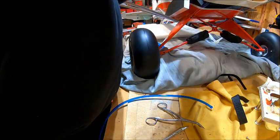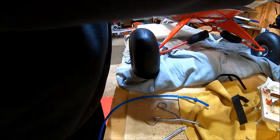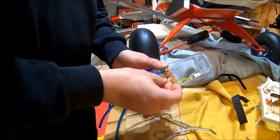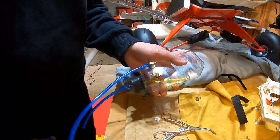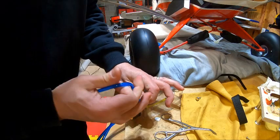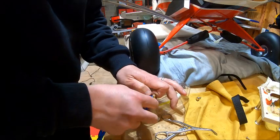Now I am going to take this out so you guys can see. I am going to pull my whole fuel tank assembly out so you guys can see that. A little bit of good old slobber for lubricant. What I am actually making here is my vent line for this tank. Once you have it good and slobbered up, you are just going to take your fuel line and literally wiggle and push. There is going to be some tension there. This way you are not cutting into the fuel line and compromising it.